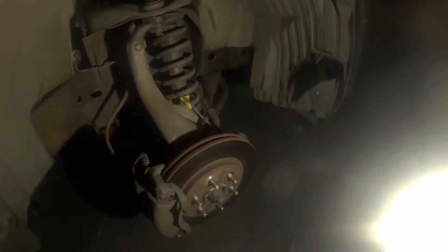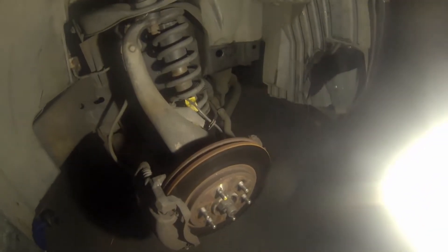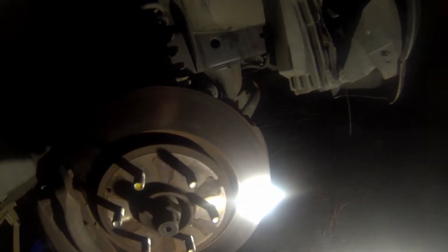We're going to get them off. This is what we're looking at and the outside really doesn't seem too bad — nice and smooth. But look at the backside — I don't know what happened back here, the pad is just completely gone or something. You can tell that is very rough. That is definitely my sound — it is digging into the metal slowly. So I should be able to just replace this pad and rotor and be good to go.